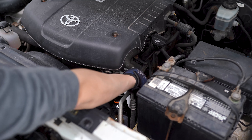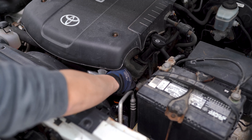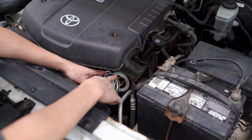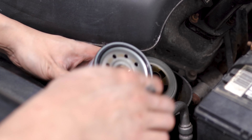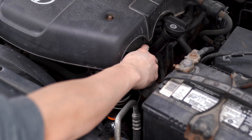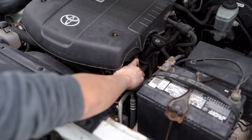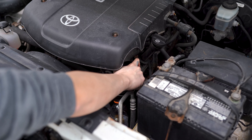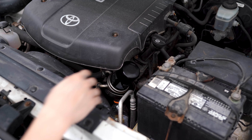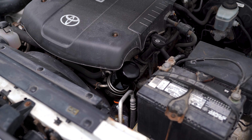Before I install our new filter, I'm going to wipe that area up. Now we can install our new oil filter. Normally I would take a little bit of new oil and lubricate the O-ring, but this one comes already pre-lubed. This is just an OEM oil filter, so that will just thread right back on there. You want to make sure not to over tighten this — it just needs to be hand tightened. The one I took off was super tight, someone probably tightened it with a wrench and it was a pain to get off. So just hand tight, otherwise you're going to make it harder on yourself later on down the road.